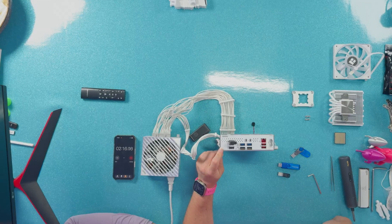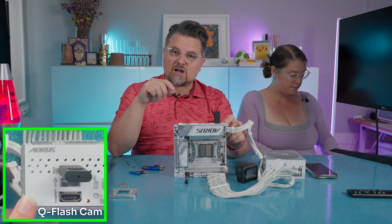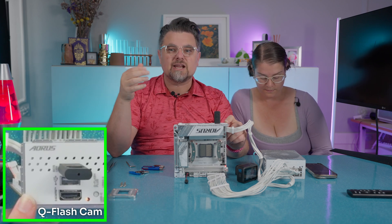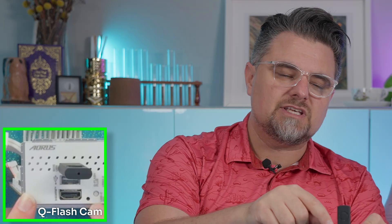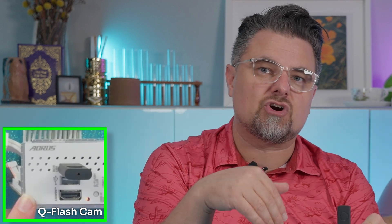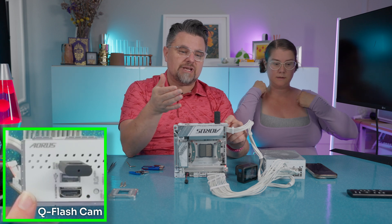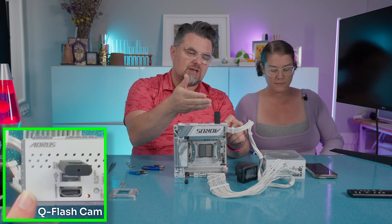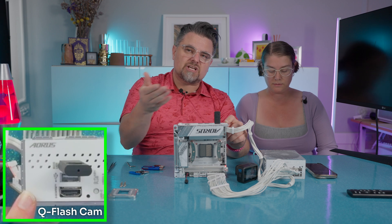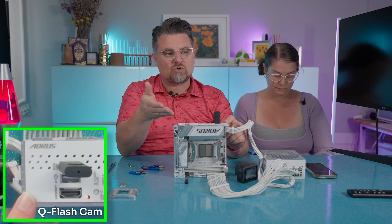Last time it was about four and a half minutes; we're at two minutes and 16 seconds now. Some caveats: you might have named the file wrong or something like that. If something's going wrong, this will go on for like 15 seconds and then turn off. That's a signal that QFlash Plus started to read the USB but something wasn't correct and it stops. What you want to make sure is that it's going on for a while — that means it's actually working.